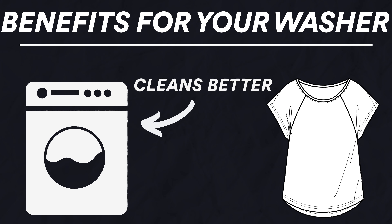That's the reason why cleaning provides a lot of benefits for your washing machine — the machine cleans better, your clothes are cleaner when they're done, and they don't get those odors and smells. If you're over-sudsing your machine — meaning you're adding too much soap — the soap suds spin out to the outer basket when the cycle is done and they stay there. They have nowhere to go, and then bacteria starts to grow on them along with the other muck from your clothes. That's where you get your odors from.